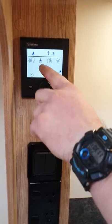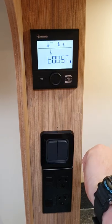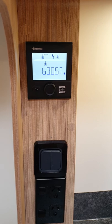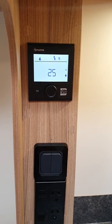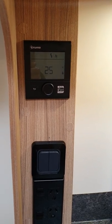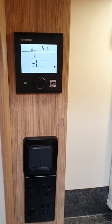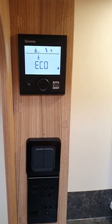So once you come out of there and go to the next one, this is your water heater. You have eco mode, hot, and boost. Boost is designed so when you first get to where you're going, you've settled your water and run it through the lines, you can then put it on boost — which just gives the water system an initial boost, basically heats the water up a bit faster. It will then flip back to the hot setting after about 15 minutes, and it'll click in and out when it needs to to maintain that temperature. Eco is pretty much the same as hot — it just heats it a lot slower. If you're not in a rush for hot water, you can chuck it on eco and it'll just trickle away until it gets to the desired temperature.